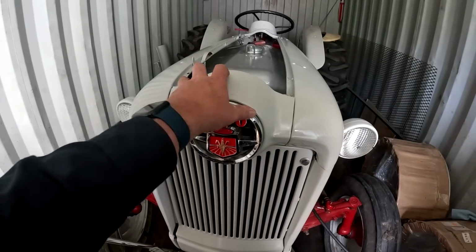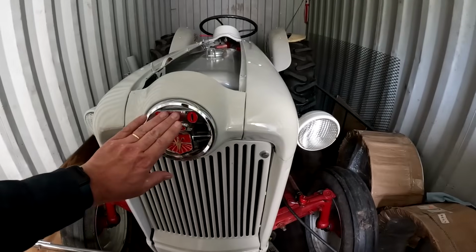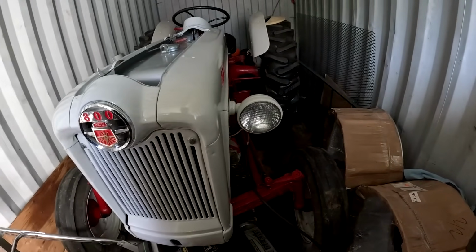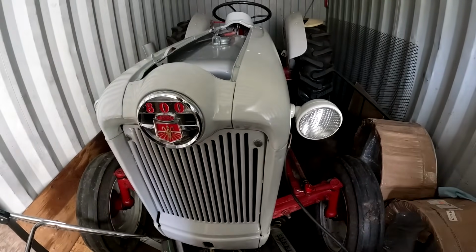So that I wasn't too happy with. And this thing's getting crubby already sitting here. This was brand new too. Oh, for God's sakes. So I think we've got rings that were too tight in there and they ended up breaking, and it's letting oil pass now.